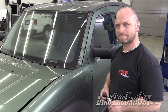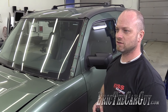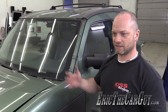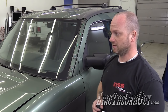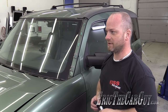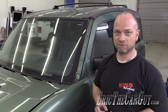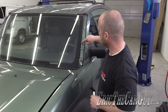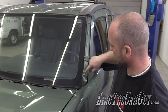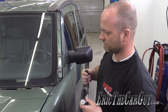I know my windshield's been replaced in the past. Does that make it easier or harder when you go at it the next time? It depends on who replaced it and what type of urethane. Some stuff dries really, really hard and some stays relatively soft. The age of the urethane also matters — if it's 20 years old it's dried out and hard as a rock. Another thing is how close it is to the pinch weld. If there's any urethane oozing out it might make it a little more difficult. This one doesn't look like it's going to be too tough to cut out.